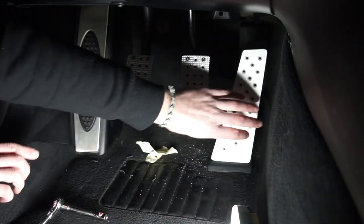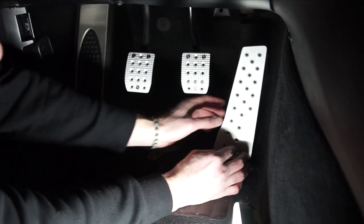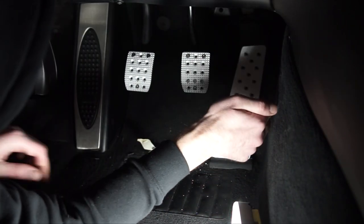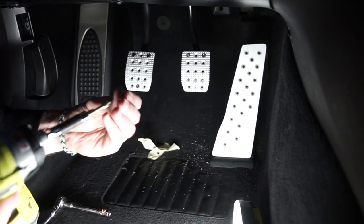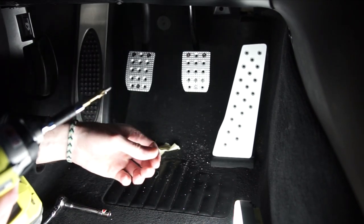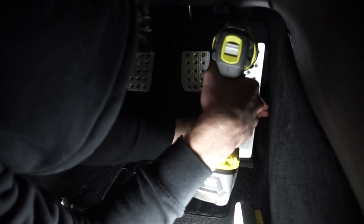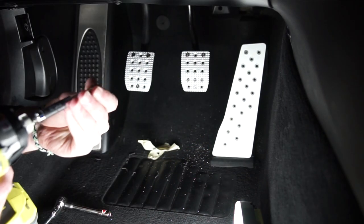Time to move on to the gas pedal. What you want to do is align it on the bottom — just lay it flat, really. When it's flat on the bottom, it's going to be pretty even everywhere else. I've already kind of marked the holes on there. You don't need a drill bit for this because these are self-tapping screws, so you just want to really go at it right away. Hold it in place, make sure it ain't going anywhere. As long as one of them is in, you're good.